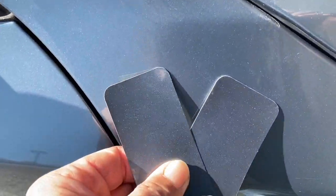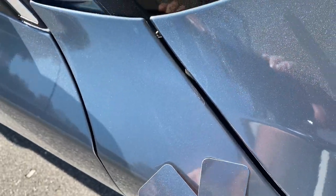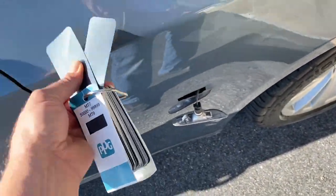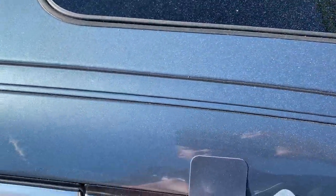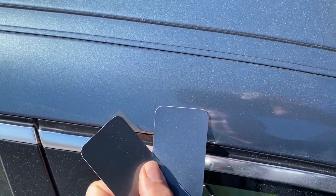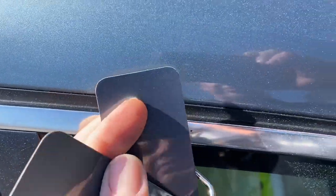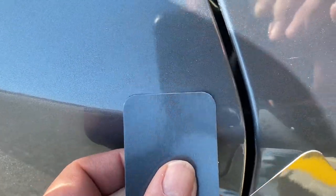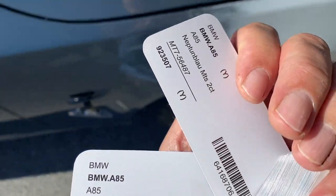I have a feeling, like I said, this stuff has pearl in it a lot of times and it causes a different flop. So let me see here. I'll come up here. I believe that it's this one. Now remember, I gotta make the comparison down here because this is what I'm painting. It's gotta match up to this. Neither one of them are bad, but we're gonna go with this one. And this one is the yellower one of the two.